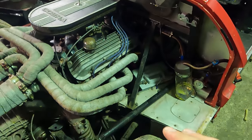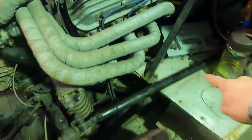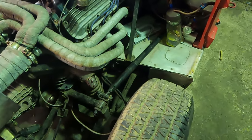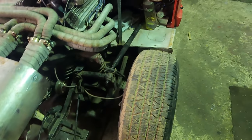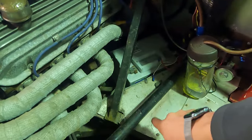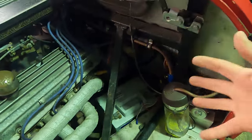Some of the bodywork and chassis work that Ivan has done is also fantastic. These rear bars, side to side, front to rear, are very, very important. They're rose-jointed on both ends and they are very, very period-correct. One thing to note: this bar here that goes over on a 45-degree angle should go straight up to ensure that it doesn't fold over if you were in an accident.